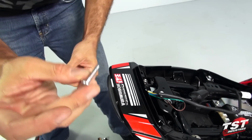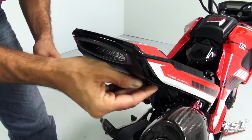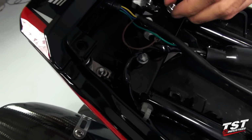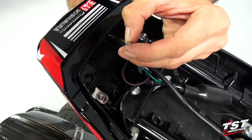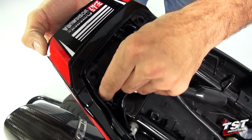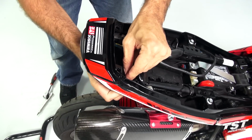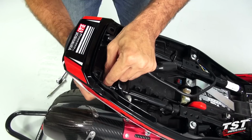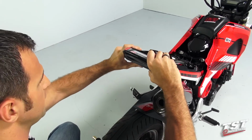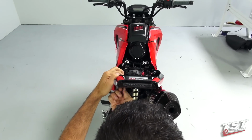We'll grab the second screw, feed it through the bottom, and from the top we'll drop another washer on top of that screw and a locking nut. Just a note here, the star component of the nut should go towards the washer. That's how the locking mechanism works. I'll thread this bolted connection in, and while looking from the back, I will align everything and make sure everything is fitting properly. And this looks good.